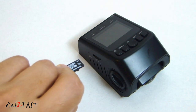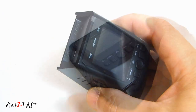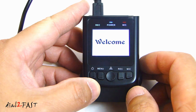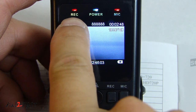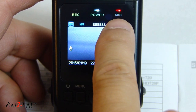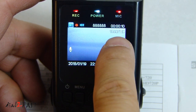The camera does not come with a micro SD card, so here I have my own memory card. I'm going to install this into the slot on the side here. So let's power this up. Once the camera is powered on, you'll see the recording has started automatically. The record LED has a flashing red. Also on the LCD there is a flashing red dot. The power LED is lit in the middle, and the microphone LED is solid red, telling you it's recording sound. On the LCD display, you have the elapsed time of the recording and it also tells you the resolution of the video recording.